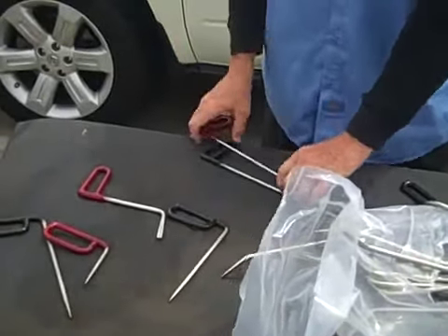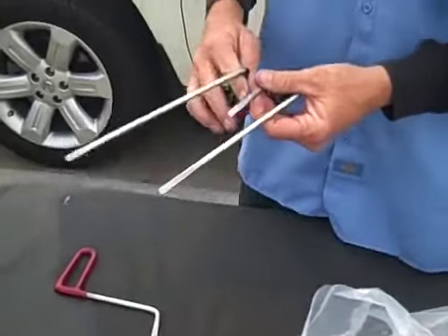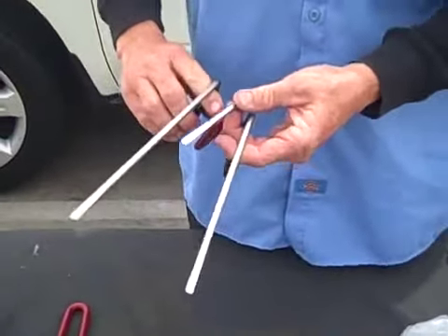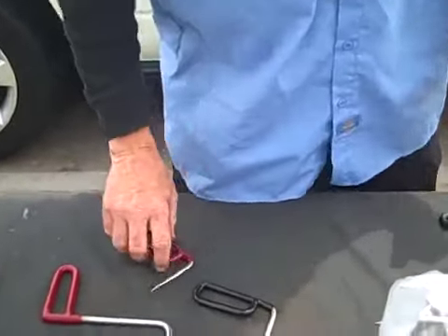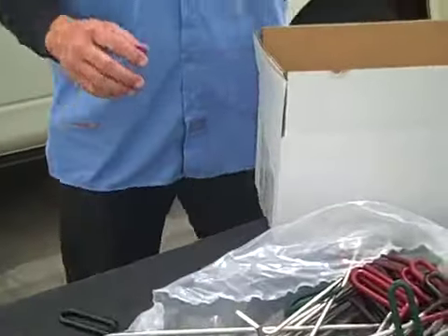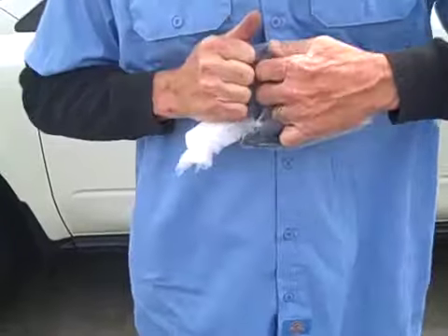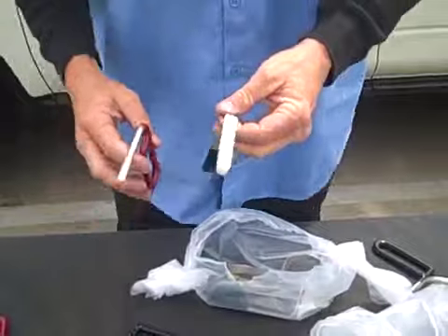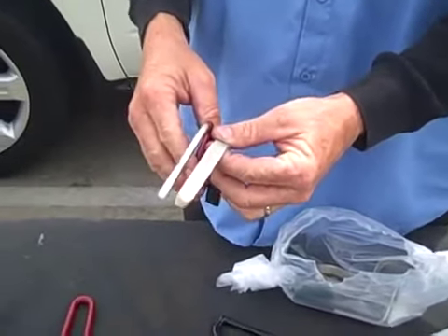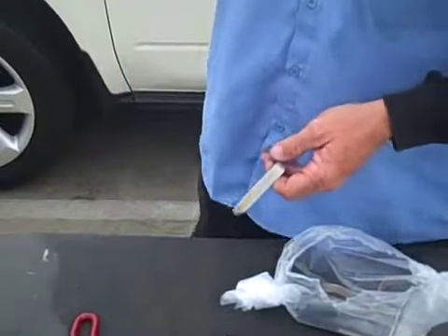You get a short one and a long one. A couple of other tools in your set are these hand tools — there's a variety of different lengths and sizes. These are for getting into tight areas, usually on a hood or a trunk area where there's cross braces. And speaking of cross braces, I'll bring out the Z-bars. Every set gets a small pack of Z-bars. These are very similar in usage to the hand tools — a little bit wider and a little bit thicker. So if you've got a little more of a gap, you can get these in. If the camera will follow me over to the hood, I'm going to show you how to get access with these tools right now.